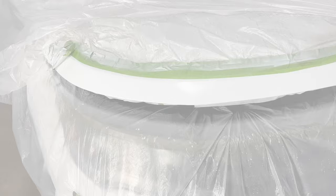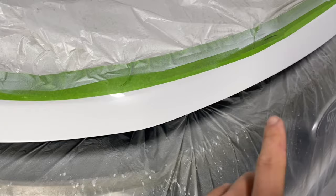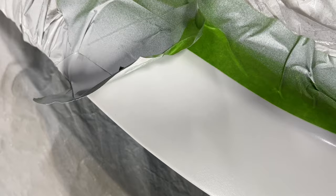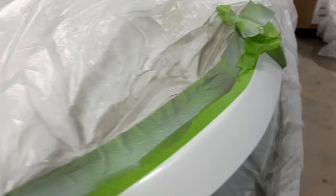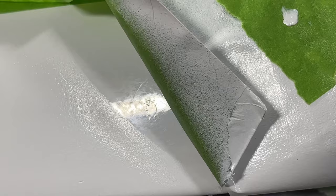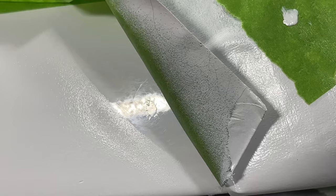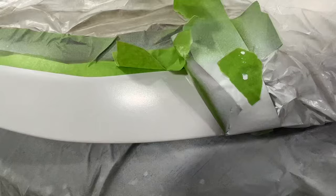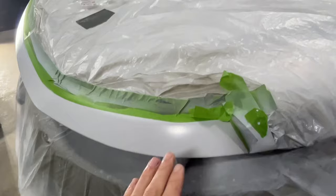It's been another 24 hours and our touch-up of the color coat looks a lot better. I don't see any of those noticeable chips down the front, and the edge here looks a lot better. It had that dark look to it where you could really see the edge of the new paint — you can still see a little bit of a line, but it is much, much better. Where we used the paint pen, that actually turned out really good. If you just needed to cover up a chip, that paint pen seemed to have good paint, good color, and decent finish even without any clear coat. Now I'm going to sand again with 2000 grit and water on the areas that I touched up, to bring it back to a uniform surface texture.